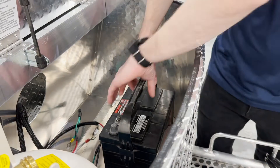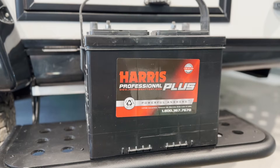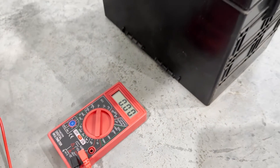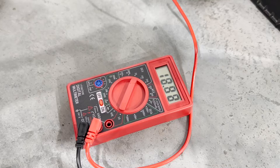And third, you can simply remove the battery from the trailer for the winter. This option is the least ideal because all batteries slowly lose charge over time. If you do not place it on a trickle charge, be sure to store it somewhere accessible and test the voltage periodically. Don't let the voltage drop below 12.4 volts.